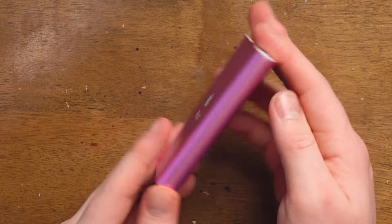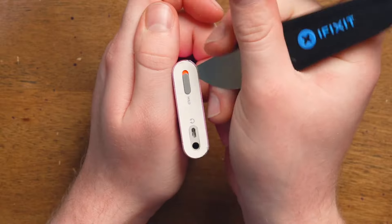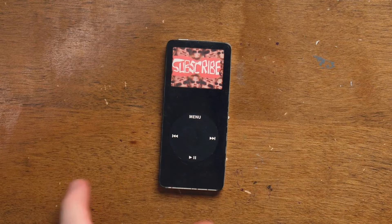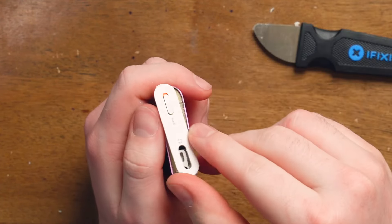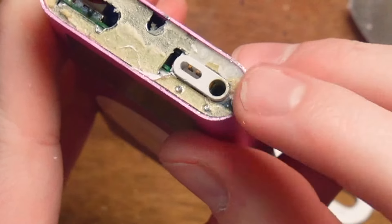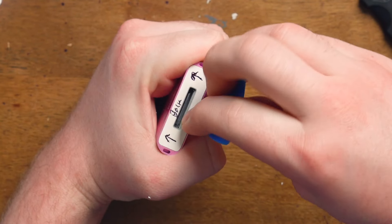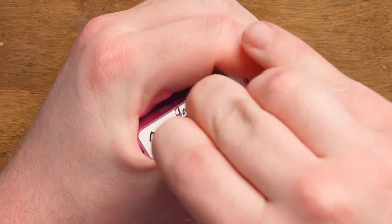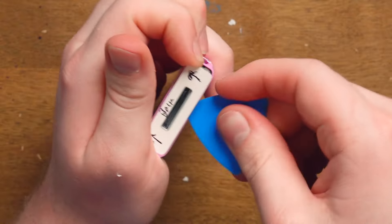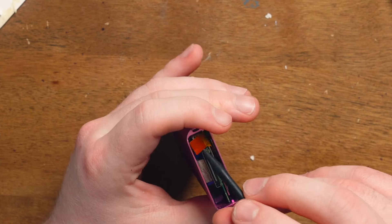That's pretty clean, not perfect. See how this is all bent up? Sliding it through there, breaking that adhesive — this is adhesive from year 2005. The second generation wasn't even sold for a year. In fact, it was released the same year as the device that replaced it: the first generation iPod Nano. I took its hat off and didn't destroy anything. There's a hole there into darkness — found another one, but that's the music hole. Now that I've done the top, I apparently next do the bottom. I don't pretend to be any expert; I've never done this before. I saw on the iFixit page that someone said to label it, since apparently this only goes in one way. I'm just trying not to damage it. This plastic guitar pick thing won't make any damage, but a metal tool will. Not sure if that was the correct way to do it, but it worked. I didn't damage anything in the process.